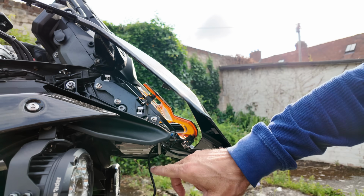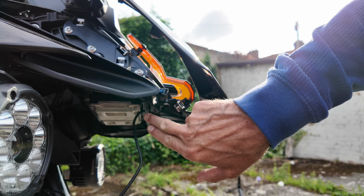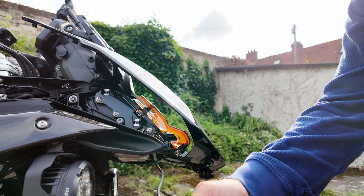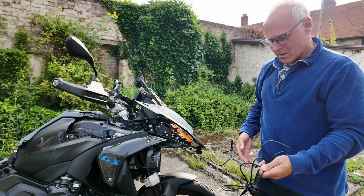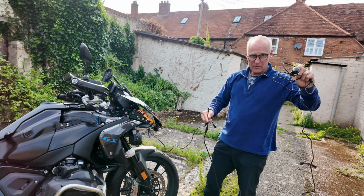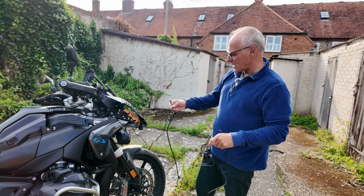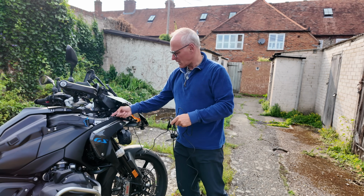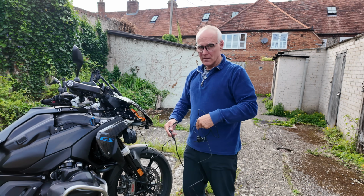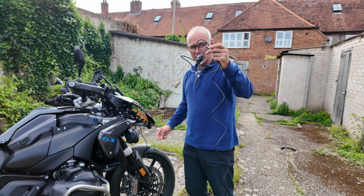Actually, you can't feed it through there because you may not have a light, so you might have to find a sticky pad and a cable tie to lock that up there, and then bring this cable back out, and then you've got your rear camera, which is here in my left hand, and this cable is going to feed up, and the majority of it's going to sit around there. But the first thing you want to do is put your front camera on, then your rear camera.